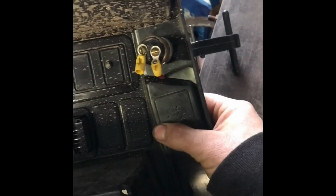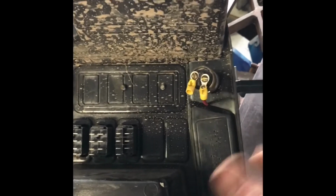You got both of those to do, and then next there's the same vents, same exact ones that go in there. We're going to cut them out of this, and like the dash, these are scribed already. You just gotta trace that cut, and this is very soft plastic, so a good sharp razor blade and watch fingers. And you can just keep tracing around and eventually it just pops out.